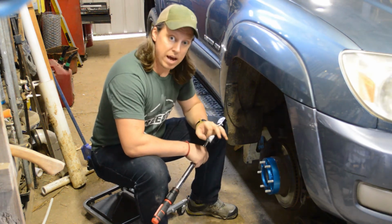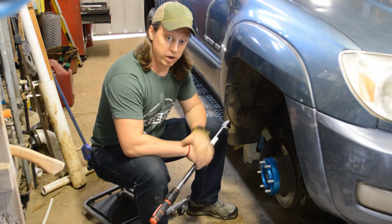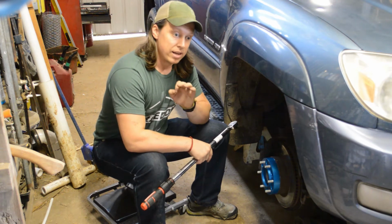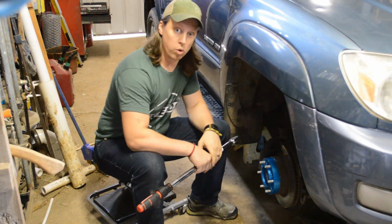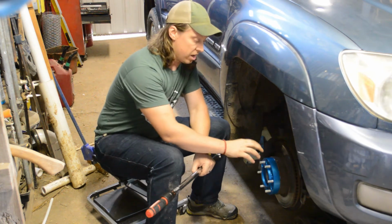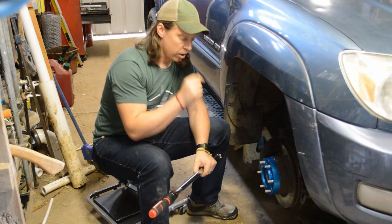Then, after I torque it down to 85 foot-pounds, I'm going to go to the final torque of 90 foot-pounds and torque it down from there. From what I've read online, getting the torque right is key to getting these installed. So sneaking up on it like that, starting with a lower torque and then working up to a higher torque, is going to assure I've got an even set from my spacer to my rotor before I put my wheel on.